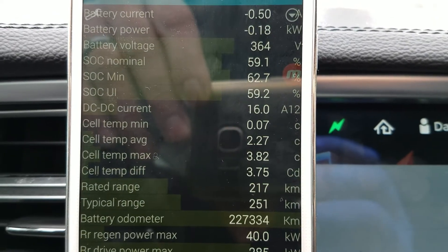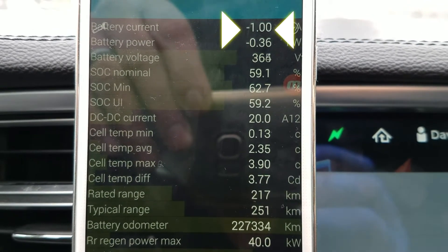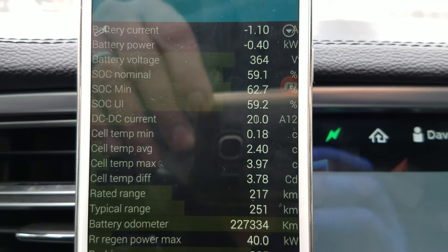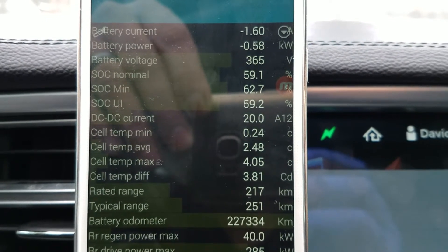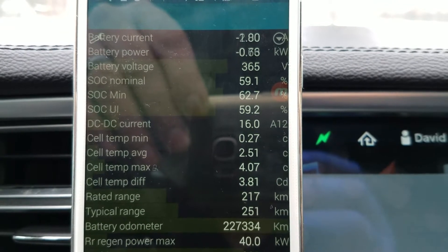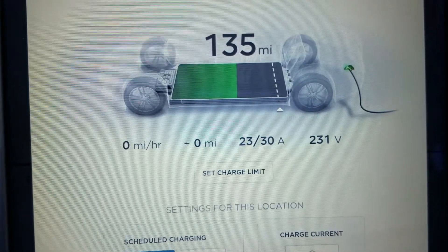Now let's have another look at the temperature — we're just going over zero degrees Celsius. If you look at the top two numbers, that is the battery current and battery power; it's starting to just get a little bit of power. It shows a negative value — negative actually means charging, positive means discharge. It's counter-intuitive but that's just how Tesla decided to have the data. So right now we're just going over freezing and we're getting a little bit of charge into the battery, and you can see the amps went up from 18 or 19 to 23.